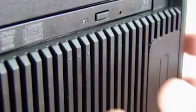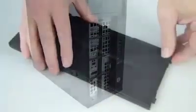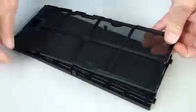Press the 3 raised dots at the top of the dust filter access cover to release the cover. Remove the dust filter access cover. Press the Release tabs securing the bottom and sides of the filter, and remove the filter.